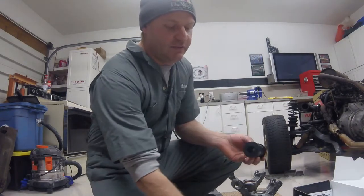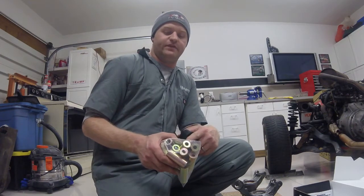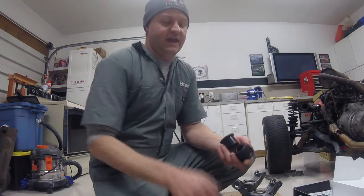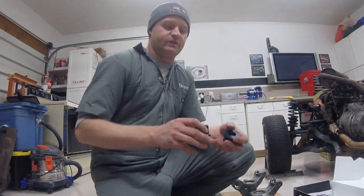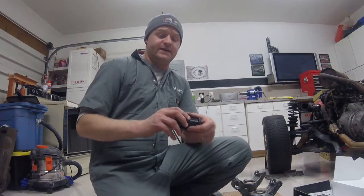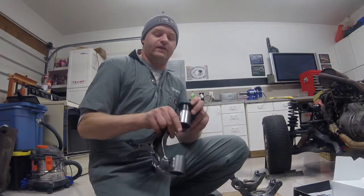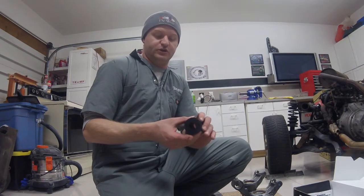Now, inside the bushing sits a sleeve. This metal sleeve is what most people think causes the squeaking when the lube runs dry on the contact point between this metal sleeve and the inside of the bushing. If you see here, there's notches throughout the bushing. Those basically can collect and hold the grease in there to help lube it up, because these are supposedly, people say, moving inside the hole in the control arm. And so that rotation is really important to the proper performance of these bushings.